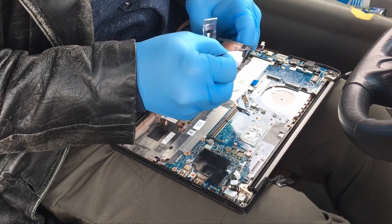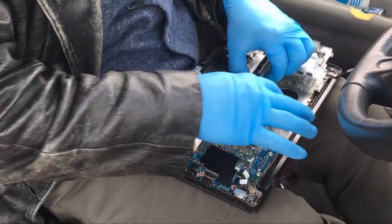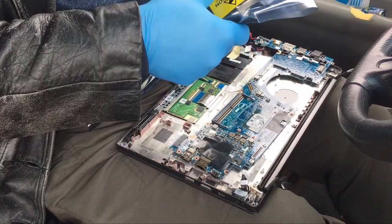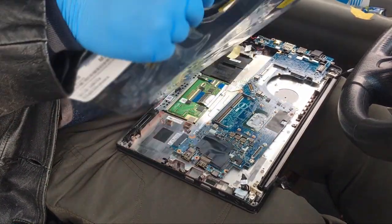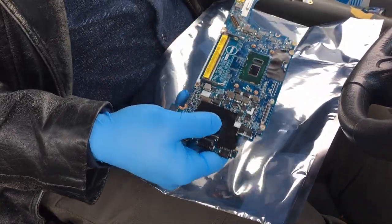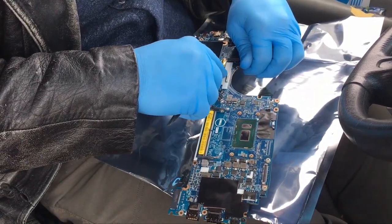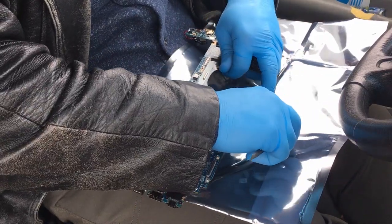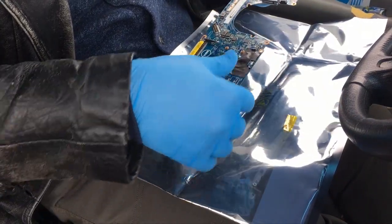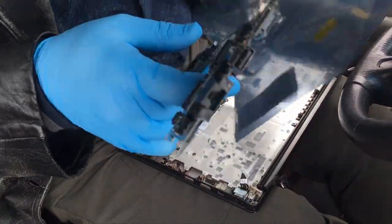You'll want to clean off the excess thermal paste — the old stuff that was there. It's a little dry, so we want a nice clean surface for when we put new thermal paste on. Lifting the board out is fairly simple; it seats into one side and a couple of little connections go into the housing, so make sure those connections slide in or out properly. The new board comes with some tape over the ribbon cable connections, so obviously remove that, then slide the old board into an anti-static bag to send in for refurbishment.